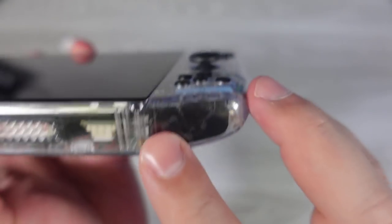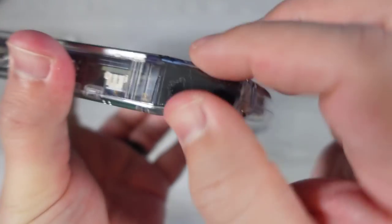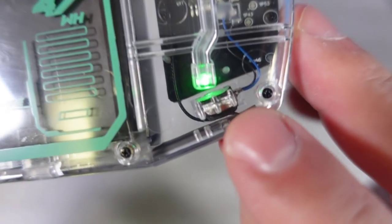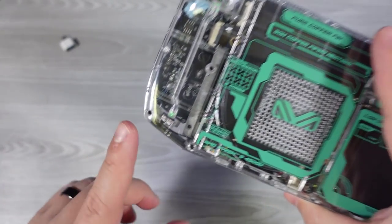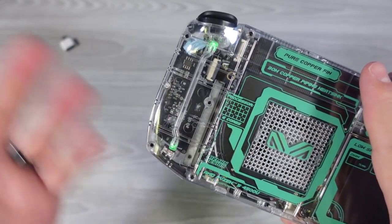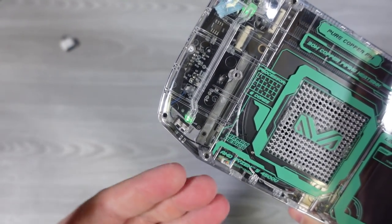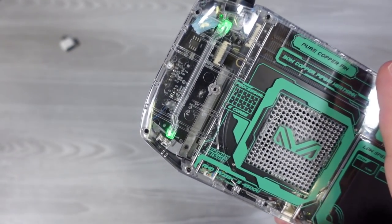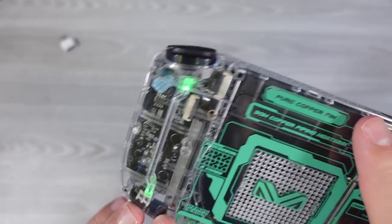On the bottom, this is also a change for the better. You can see rubber feet stickied on, and here you can see the rumble motor — it also says '1T' for the 1TB model. The rumble motors are sitting on top of a membrane that is dampening them. So if you went back to my previous video where you heard it extremely loud, this is now completely fixed. It is a proper rumbling game controller now. It's perfect — there's good nuance to the rumble, it's not overly loud. Before it was literally on or off, but now it has a good full range. This is a big improvement over the pre-production model.